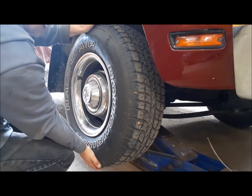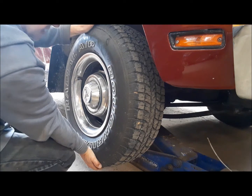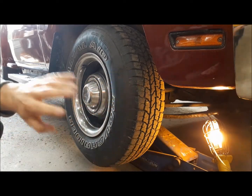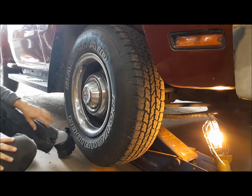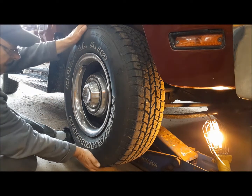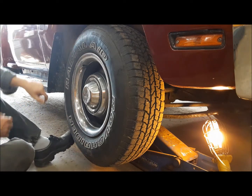So we've got this jacked up and I do feel a little play there. We're going to have to see — is that the ball joint or the wheel bearing? All we've got here is just a little play in the wheel bearing. I'll take it apart and tighten it up. I'll probably just have to turn the nut one notch. These always have a tiny bit of play in them, so that's not terrible, but we'll see if we can get a little of it out.